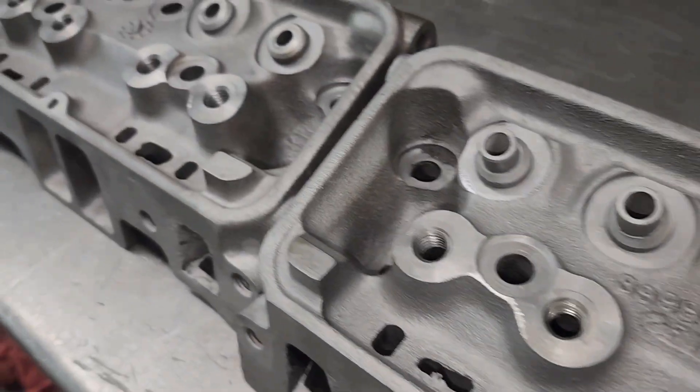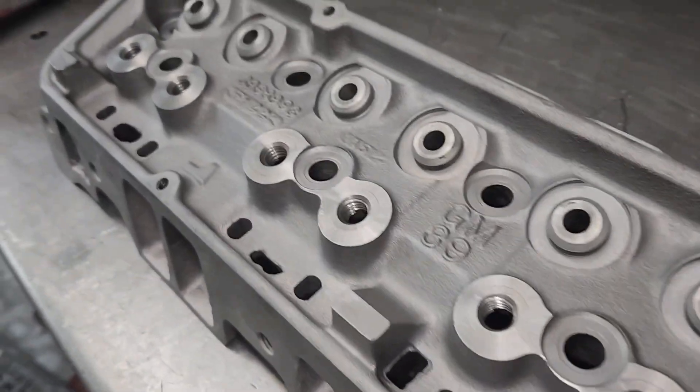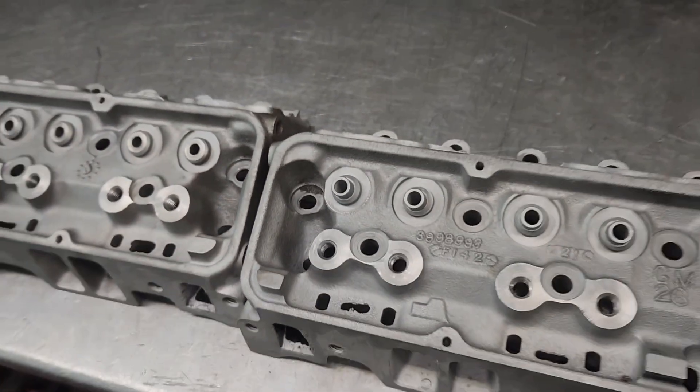That's a set of screw-in studs on small block Chevrolet heads. On the next video, I'm going to be putting valve guides and hardened exhaust seats with a 1.6 stainless steel exhaust valve. We're going to be putting ARP studs in these — they're great studs. If you have a small block with any kind of cam, I don't build an engine with these press-in studs because they can just suck out for no reason and then you've got bad problems on your adjustments. I did a video on pulling studs if you're trying to do it at home in your car — there's a link in the description. You guys have a nice night, be nice to each other. I'll be back tomorrow — I've got some Yamaha Marine heads I'm going to be surfacing. I've never seen a set of them, kind of weird-looking heads. Bye.